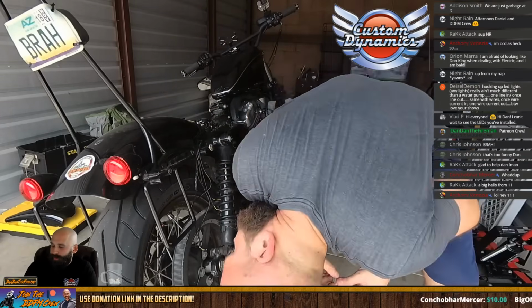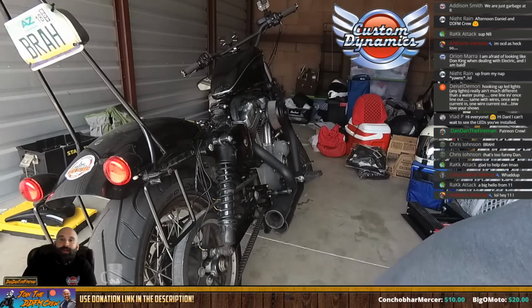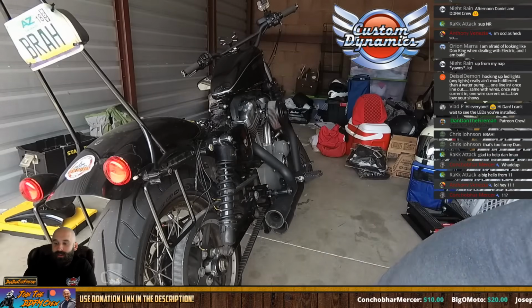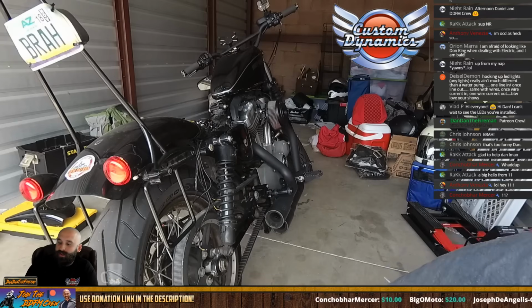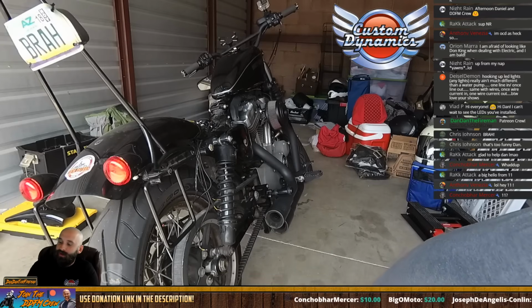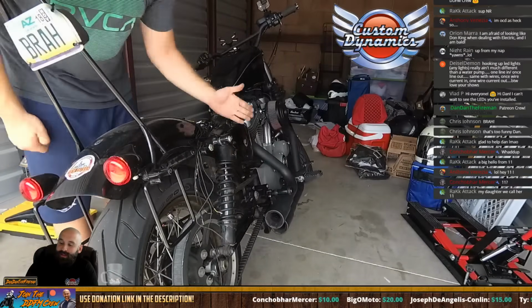He called me and I talked to him. We troubleshooted it. We got it working. So this was the email he sent her, Angelina. Spoke with Daniel. He did not have a circuit tester on hand, so we disconnected a bundle of black ground wires from the cage clamps and connected them to a chassis ground, and the LEDs illuminated.